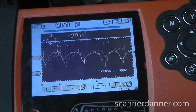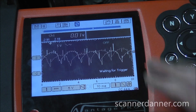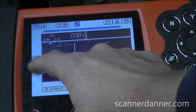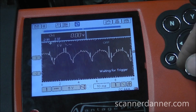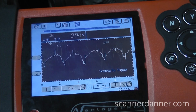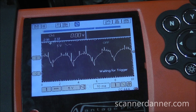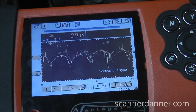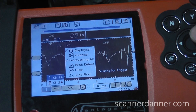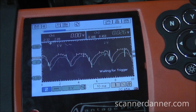The little ripple you see on top is not a problem — the bad diode here is the big one. It's pulling the whole system up and down; we don't want to see that. This AC voltage is pumping through the entire system and it's affecting the speed sensor signal, which is also an AC generator. Why is it the speed sensor in particular? Because the output speed sensor in this car produces an AC sine wave. I've already connected my second channel to the output speed sensor.